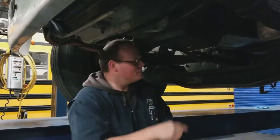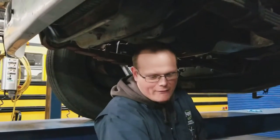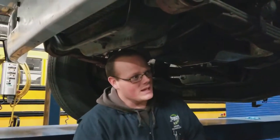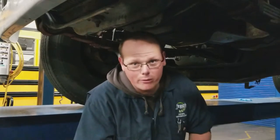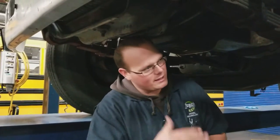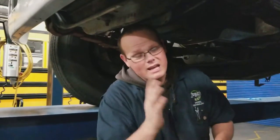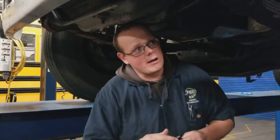I hope this was helpful. There's a lot that goes into a minor inspection, and this is a quick overview. This inspection usually takes anywhere from half a day to a full day to do properly, because of all the greasing and checking you have to do. Any issues you find need to be marked down. Fixing something — unless it's something simple like a light bulb — is not something you do during an A-series or minor inspection. That's something you pass off to the technician if you find a broken linkage or a king pin that's out of spec. You document it and push it onto the next tech. Thanks.